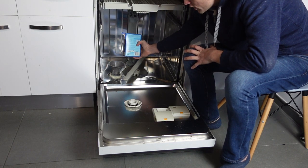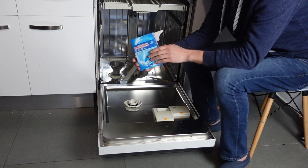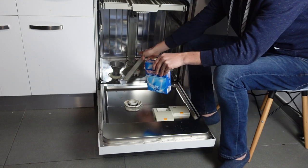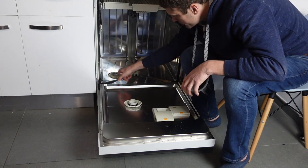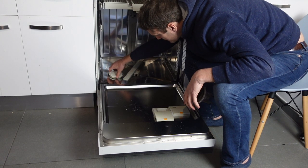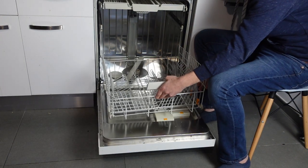You're just going to go ahead and fill it up each time. This is a one kilo box, and when the dishwasher is empty it will take about a kilo, so you can empty the whole box. You just have to move the salt around a little to make room. Once it's full you can see the salt in there. Then put the top back on, put your rack back in, and you're ready to wash some dishes.